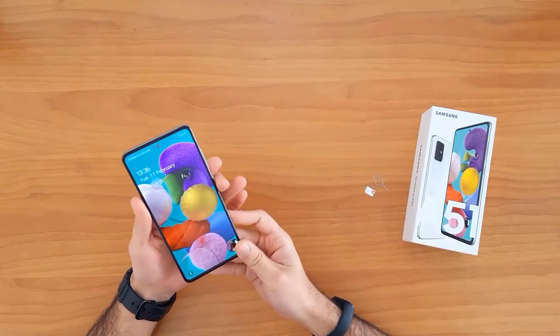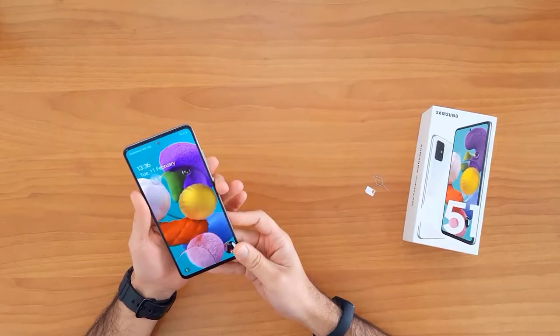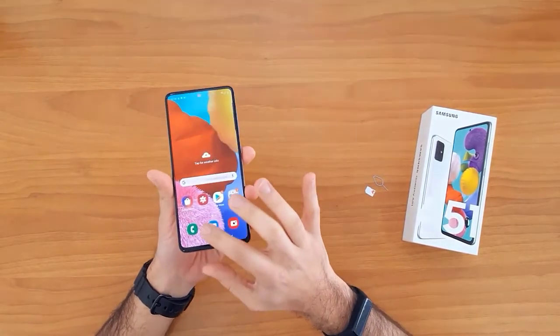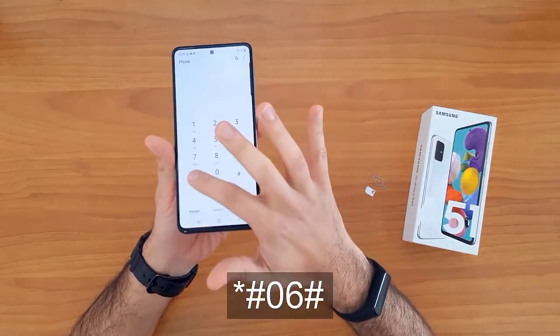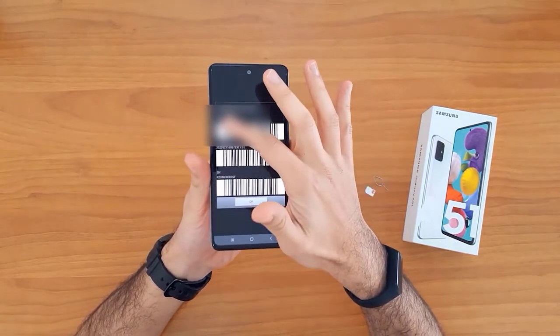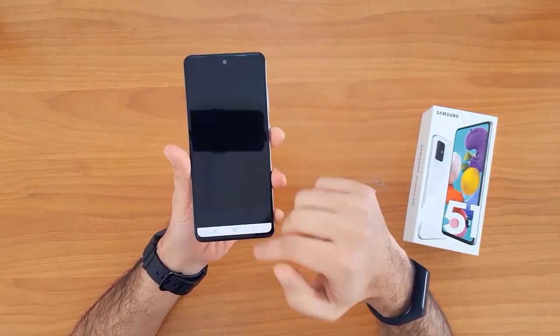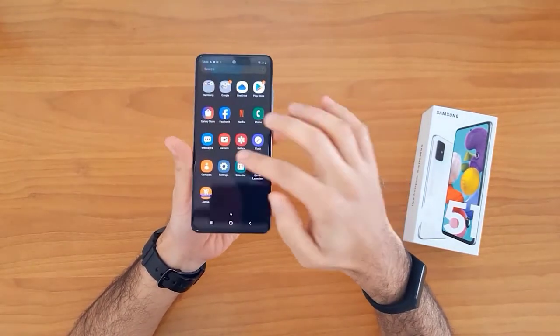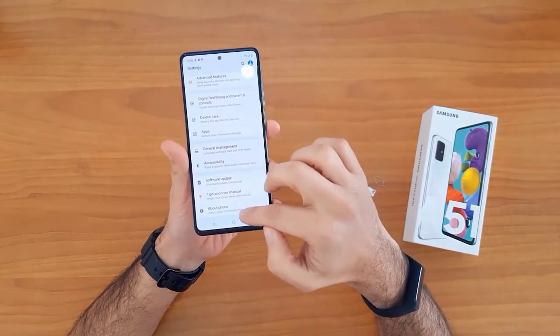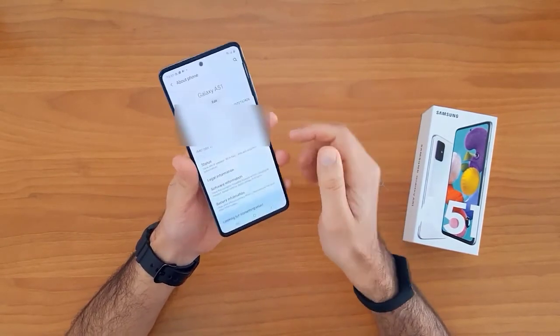Like O2, Tesco, Vodafone, or any other SIM card outside the United Kingdom. The first thing we're gonna do is get the IMEI number. To do that, we go to the dial pad and dial star hash zero six hash. The IMEI will automatically appear on the screen. Alternatively, we can go to Settings, then About Phone — the IMEI number is shown there too.